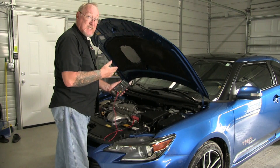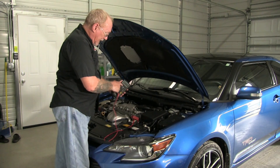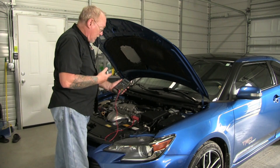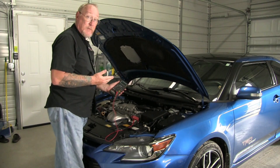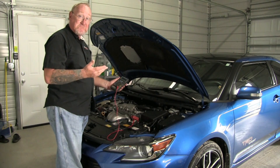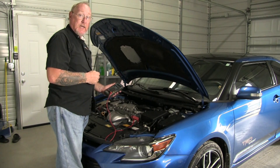And if you get a reading of 15, 16, even 17 volts, you want to make sure that's the way it's supposed to be and not the indicator of a problem. After the high voltage is looked at, we hit the record button again and get the minimum voltage — the loaded voltage. Here I'm reading 9.5. That's borderline. That's not atypical because I'm dealing with a 2014 model car, so it's going on three years old. From my part of the country, that's pretty typical for battery life. We just may want to consider putting a new battery in to head off any problems.